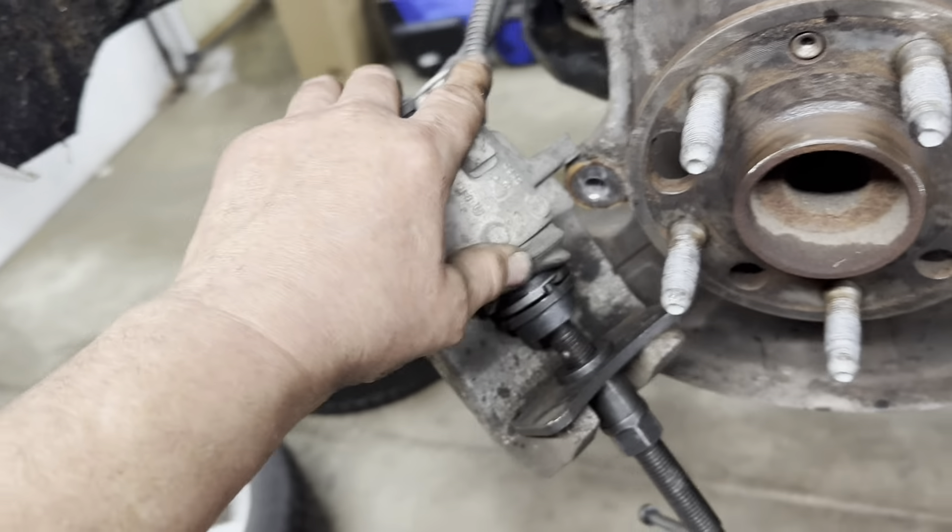Now this is the driver's side — metal to metal. I won't know if the piston is frozen until I try pushing it in. If it pushes in really hard, that's a problem. Also make sure the slides are free. The pads are frozen in there like you wouldn't believe — rust expands and keeps things from moving, so that's one good reason right there for the brake failure.